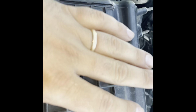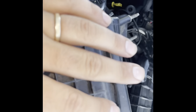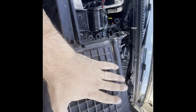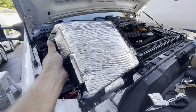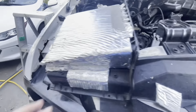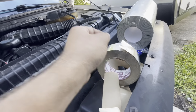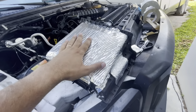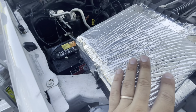One more thing I'm going to do is grab some stick-on insulation and try to put it around this, because all that protects this from the heat of the engine right next to it is a little tin cover. So I'm going to see if I can improve the insulation a bit. I call it the Super Chill 9000. I just bought this roll of insulated duct tape, slapped it on here and then used some really skinny metal duct tape to help the adhesive on the corners stay down. Then that tin shield would just loosely slip over the top of it like it was before.